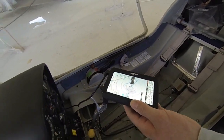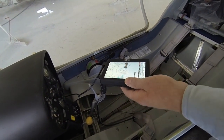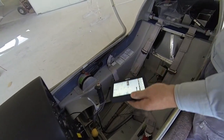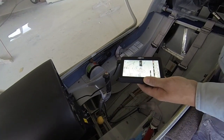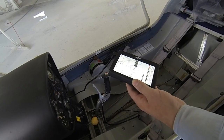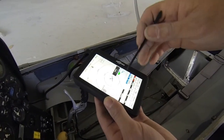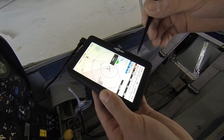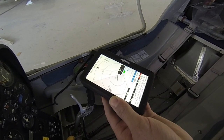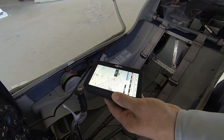So there's all that. My favorite page — you can cycle through the pages — is this one here, which shows the current LD and the required LD. You can set that to either the next turn point or the end of the task, like home. It tells you what you're achieving now and what LD you need to get wherever you're headed.